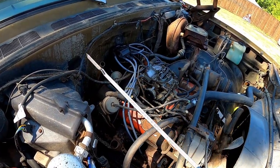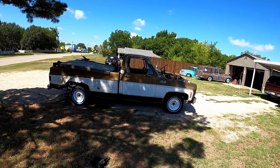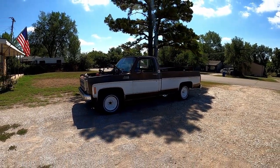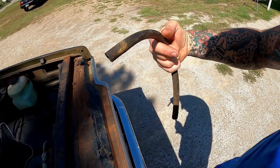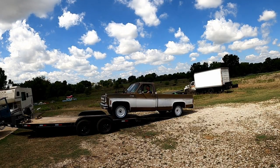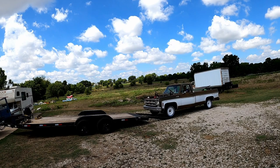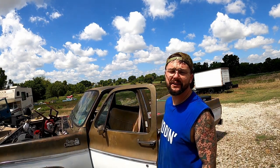In the will-it-run video I checked our transmission fluid and it's just as pink as can be. I talked to the previous owner and he said believe it or not that transmission probably only has 5,000 miles on it since it was rebuilt - so that explains why that fluid looks so good. Speaking of looking good, it's a shame the one side is beat up because this side looks pretty good. I pulled on this the other day when it was running and it basically fell off - I think that may be our small vacuum leak right there. A shiny new three-eighths piece of hose will get her done.